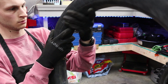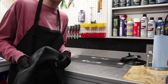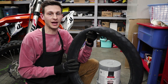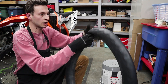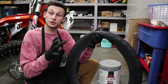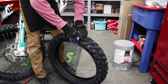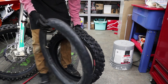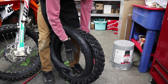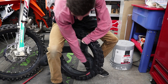I'm going to be reusing the old tube. I filled it with air and made sure there were no leaks. I know it's good practice to replace your tubes every time you switch tires, but this one checked out. So take your tube — if you're reusing your old one, go ahead and put that valve core back in — and fill it with a little bit of air. You want just enough but not too much. More air means you're less likely to pinch or fold the tube when you put the tire back on, but too much and you'll have an impossible time mounting the tire. Then start stuffing the tube inside of the tire. If the tire is really narrow and it's hard to get the tube in, a trick is to sit on top of it — it'll open up those two beads so you can work it around.